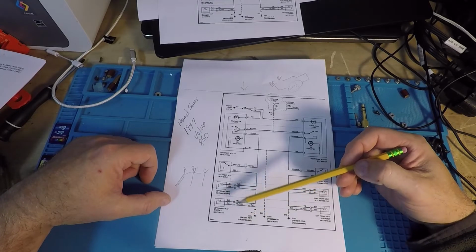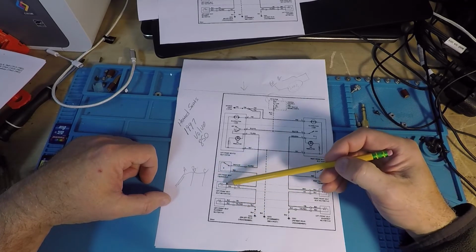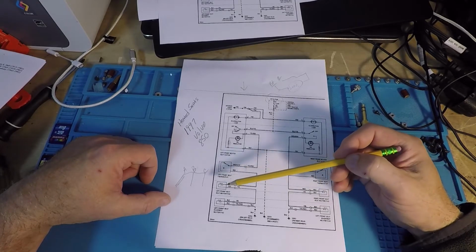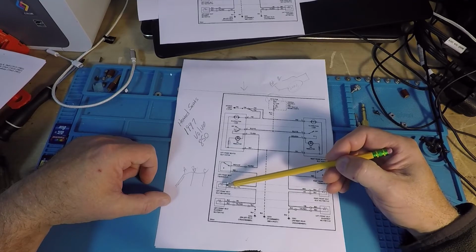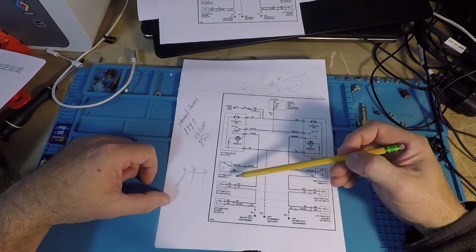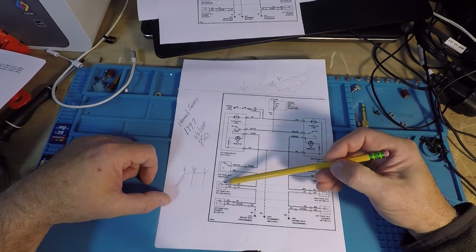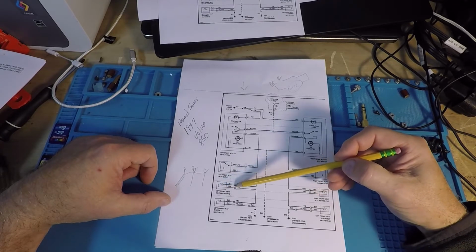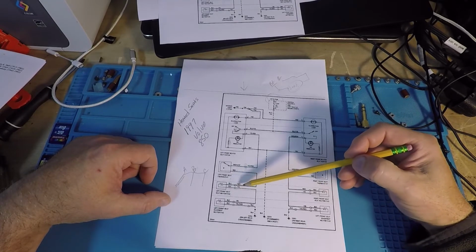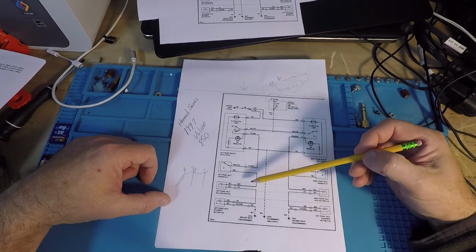So if you watch the S61, it's basically a load. In the case of this, it's a heat generating load. It's going to regulate, but it's going to generate heat as a function of current flowing through it. So this is where you get your warm seat. Now, red comes in, it goes through the circuit, it comes out via a black, well, these are both black on the seat, but don't worry about that. It comes back out as a yellow wire. Again, I'll show you the connector.